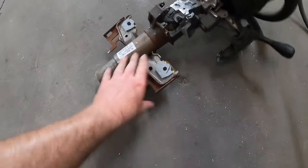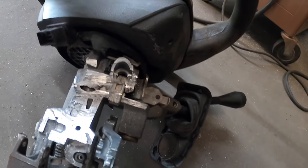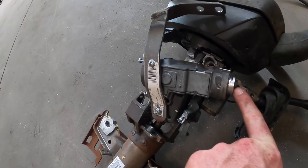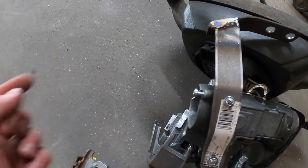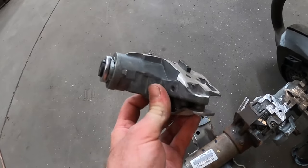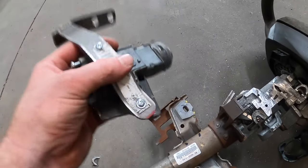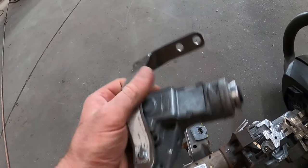I have completely cannibalized and ruined the steering column. What I did - this piece here lived right here, and your ignition switch goes in this side with the tumbler. On the back side it's got a little plastic piece that screws in and turns the tumbler that starts the car. I cut this section out, this housing, ground it down, gave it some shape. The ignition switch is removable so I took it out and taped everything up so no grinding dust got inside. It had two little four-millimeter holes.